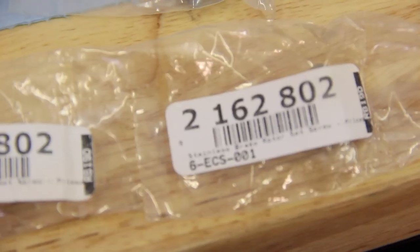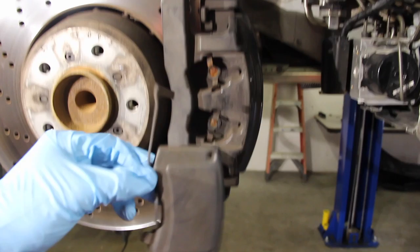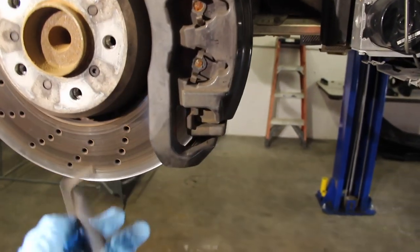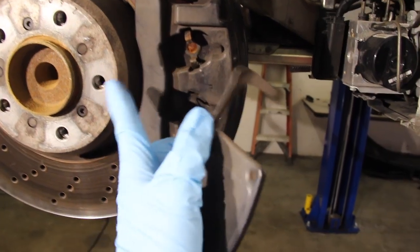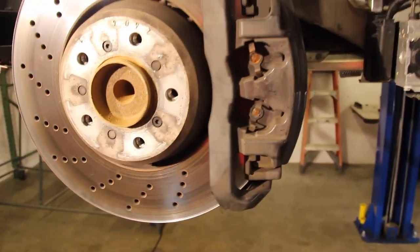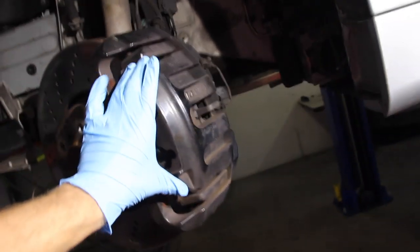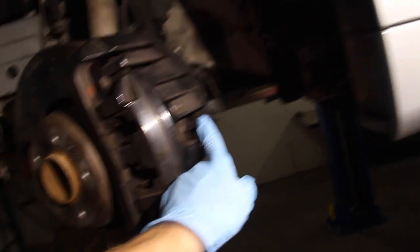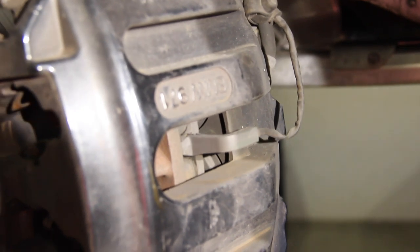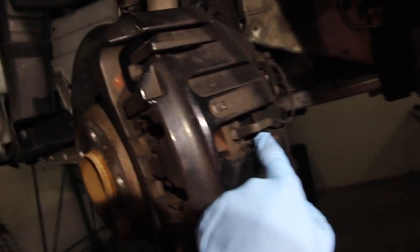The first thing here on the front axle is this little dust cover, and it sits right here. I popped this off by just sticking a flathead screwdriver right in the center and prying it out - it pops right off. So have your hand there to catch it and put that in a safe location. On the front driver's side, I went inside and turned the steering wheel all the way to the right. This gives us a nice view of the side of the caliper - it is a huge caliper. We can see there is indeed a wear sensor here, the little wire sticking out on the side. As your pads wear down, it will eventually wear through the plastic, and when the metal sensor meets the metal of the rotor, it completes a circuit and tells you to change your brakes.